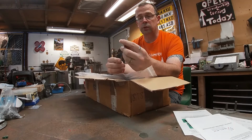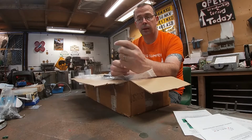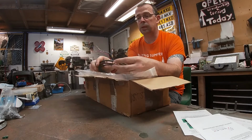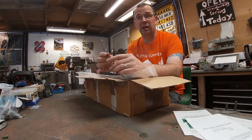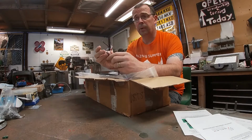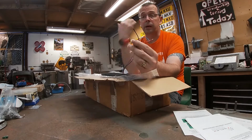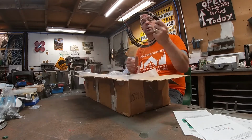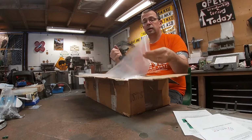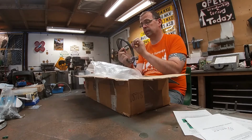That's going to get soldered into a 2-pin Clansman power supply plug, which is a bit different from the instructions that you get with this, that say it should be wired into a cigarette lighter, but I'm going to wire it slightly more permanently, and it saves me having a cigarette lighter plug running from behind the driver and passenger seat into the cigarette lighter on the dash. So power cable, decent long length. We'll have to see how much of that cable we need to use.